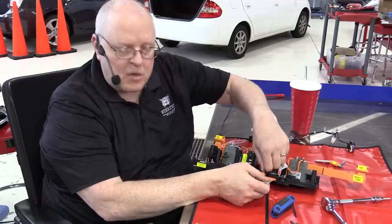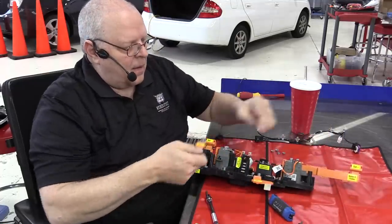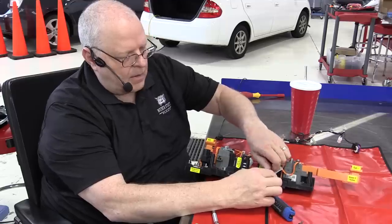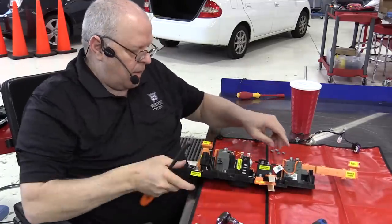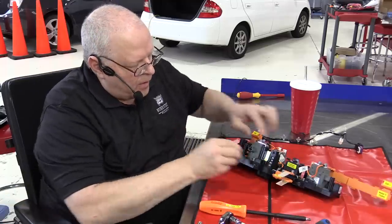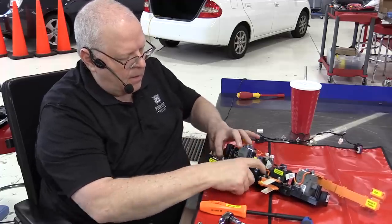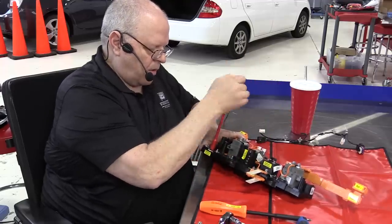that sticks out the front of the battery and goes to the two big heavy orange wires at the front of the battery. And then we have our positive terminal of the battery that connects to the positive contactor, and once it closes, it feeds current to the positive terminal here that connects to our big heavy orange wire under the vehicle. Just like that. All right, there's a couple of screws that hold the current sensor in place. And then we've got four nuts, two that hold the fuse down and connect it to the charger positive, and one that connects to the charger negative. And the fourth one over here picks up negative from the outside negative terminal there on the big heavy orange wires.